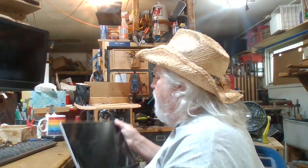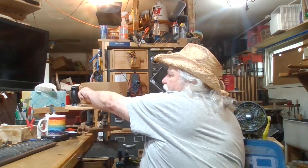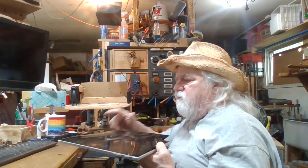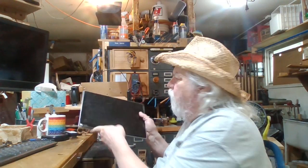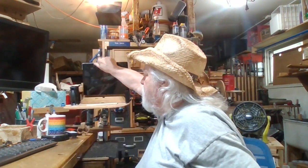Now that it's warped, this thing actually works perfectly and the screen looks fine on it. The problem was the overheating — that's why it was messing up. So what I did was I put this fan — just a little USB fan — plugged into the USB port over here so it comes on whenever I turn on the computer. What it does is blow air right in between here completely. This thing has been running very cool and it's been running fine ever since.